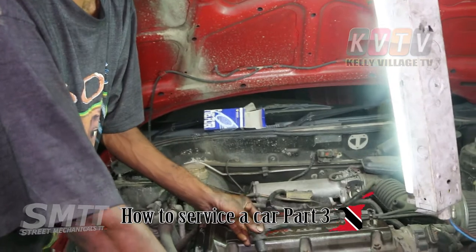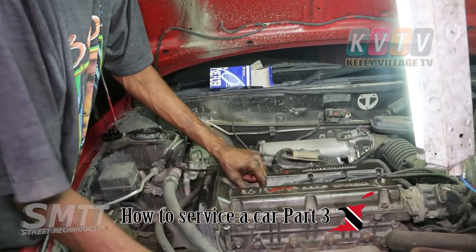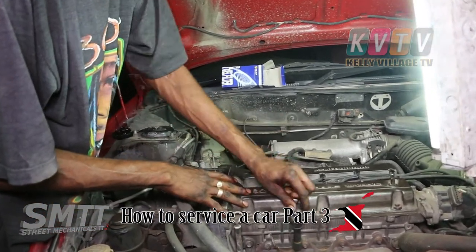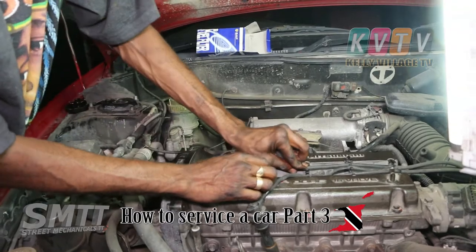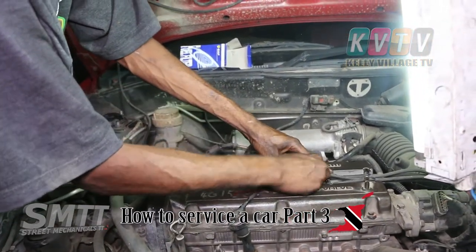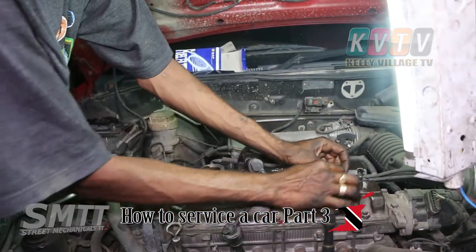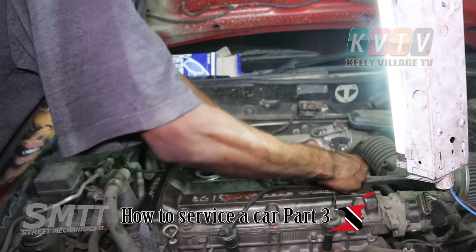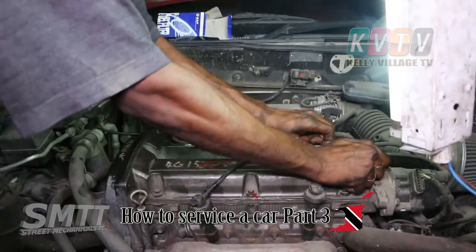Every lead you have to make sure you put it back in place. Number one is here at the front of the engine — that's number one. Make sure you put that plug on your side, number two on your side. If the plugs get mixed up, the engine could idle with a miss, you could lose power and end up in real problems. Take them out in order, put them back in order.